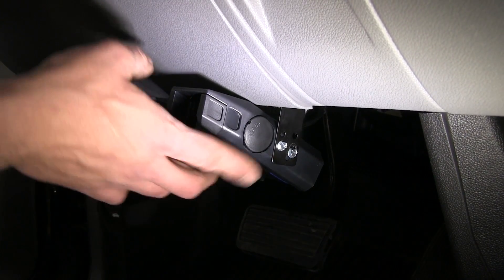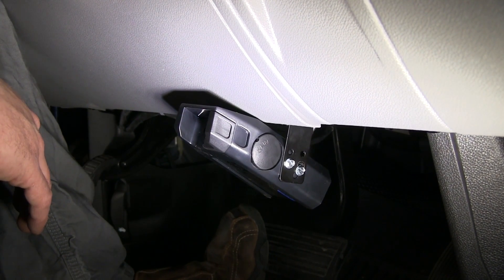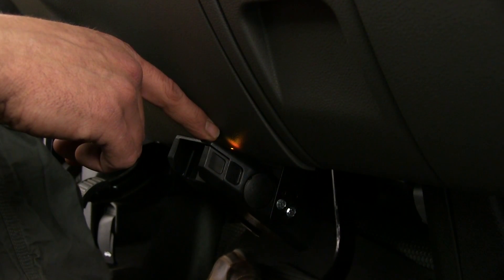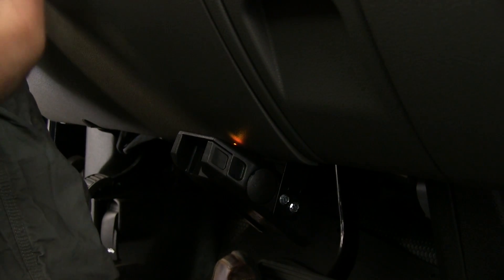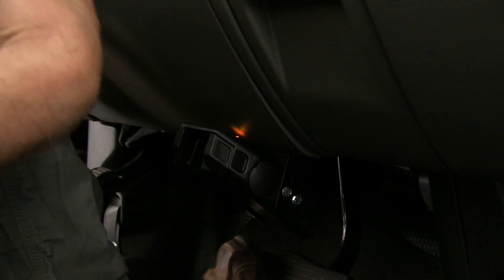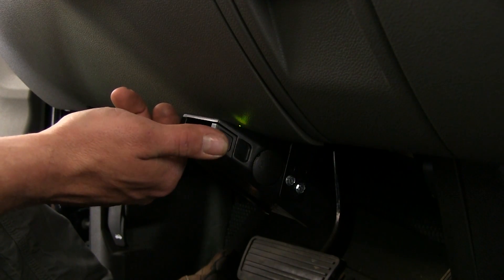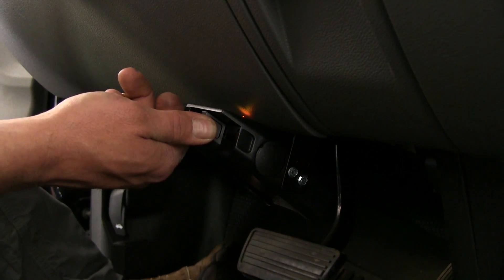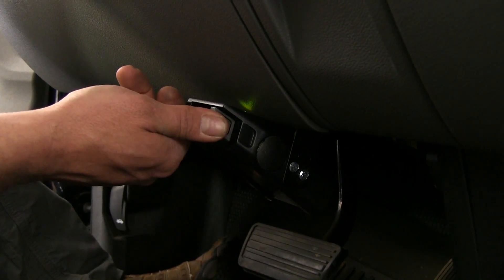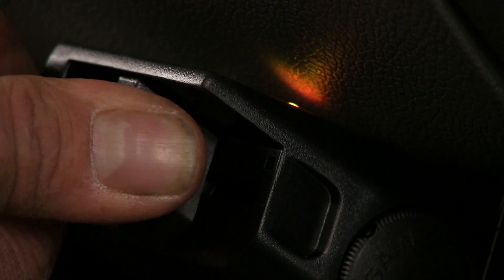The proportional aspect is nice because if you slowly apply your brakes, the gain slowly comes in and slowly activates. If you quickly press the brakes, it immediately goes into full braking or emergency-style braking power. The slide bar lets you manually apply braking force to the rear of your trailer, allowing your trailer to slow down your vehicle if you choose.